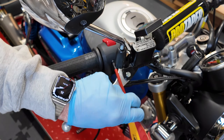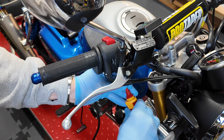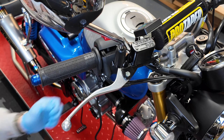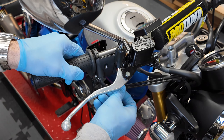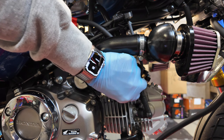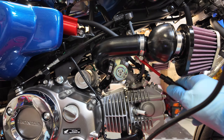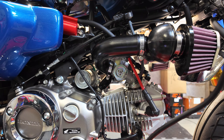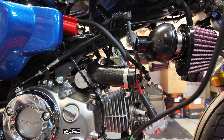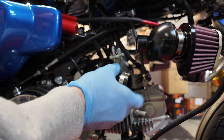The throttle side is slightly different. This bike is fitted with a quick action throttle tube, and to be fair they're about a tenner, so rather than fight to remove the old grip from the tube I'm going to remove the whole thing, insert a new grip on a new throttle tube — I'll put the link in the description. This involves disconnecting the cables from the throttle tube. Because we have the DNA Stage 3 kit installed, we've also got to remove the pipe that connects the throttle body to the plenum.